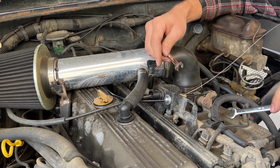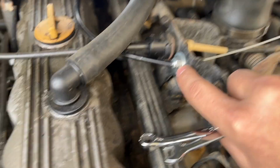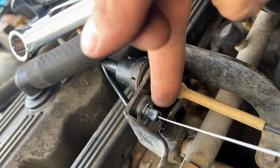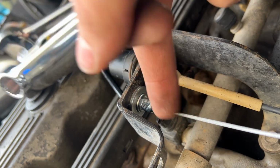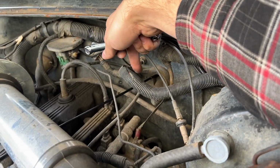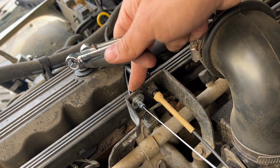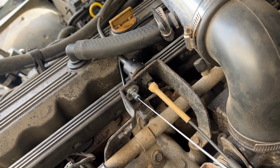I use a small nut, which is an 8mm, then a large nut, 10mm. Big supplied washer, slightly smaller supplied washer, 10mm nut. And on this side of the bracket, big supplied washer, smaller supplied washer, smaller 8mm nut, and then the banjo bolt that the cable comes through. So, through the firewall, to the factory bracket, opening the factory bracket. Again, if your Jeep has cruise control, you'll have a cable here, so you'll have to either drill here or here and add that extra bracket in, but luckily for me, I'll keep it easy that way.